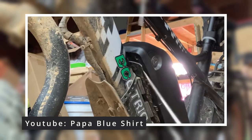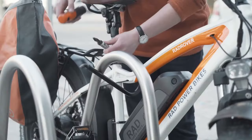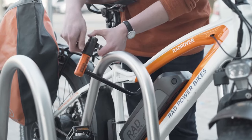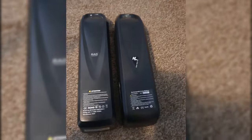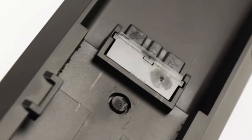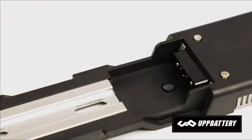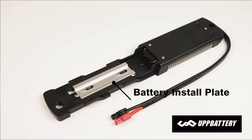Be aware that these locks are pretty basic and are usually able to be circumvented pretty easily, so if you're going to leave your bike for long periods, I'd recommend taking your batteries with you if you're able. Even if these third-party batteries look similar to the battery that came with your bike, many times they will have different tray connections that will prevent you from simply swapping one battery for another. So you'll probably not be able to simply purchase a similar style battery and switch out your OEM battery for a larger third-party one.